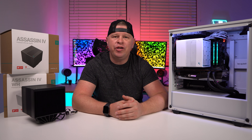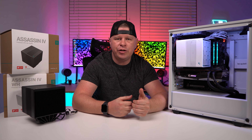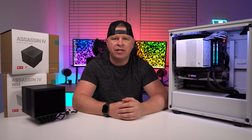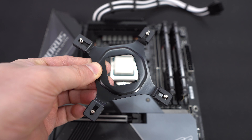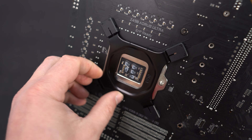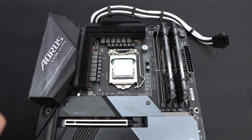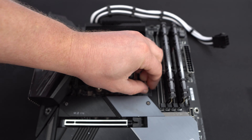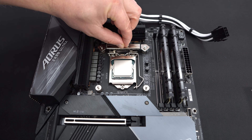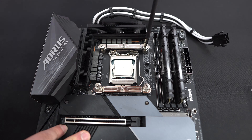When it comes to installation, we're going to be doing our installation on an Intel Z490 system, meaning the process should be pretty much the same across all modern Intel sockets. The first thing you want to do is find the Intel backplate and attach it through the backside of your motherboard, lining up the pegs with the holes. Then take the Intel spacing screws and screw them onto the pegs to secure the backplate. Find the Intel mounting bars and secure them in place with the included thumb screws — these need to be installed on the top and bottom of the socket.